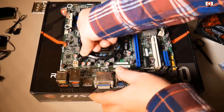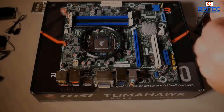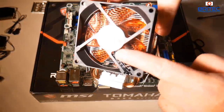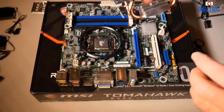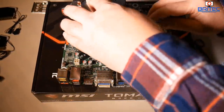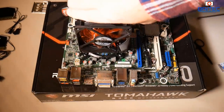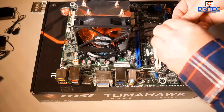I should have put the black mounting clips in before applying the compound, but no big deal — just push those in now. You can spread it out, leave it as a blob, or put it as a line. I'm positioning the fan exhaust facing toward the back of the computer so the case fan can extract all the heat out the back, with air intake at the front.